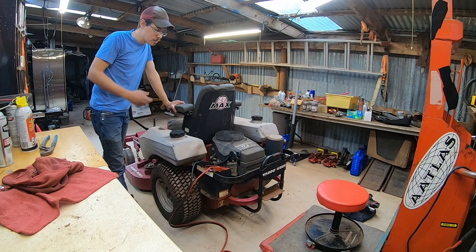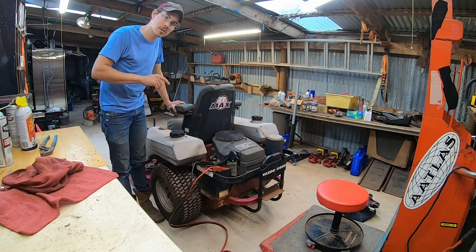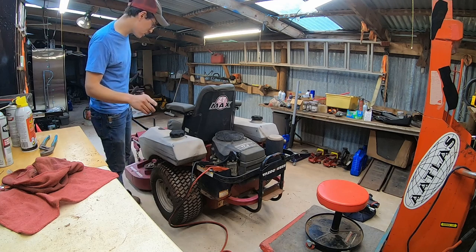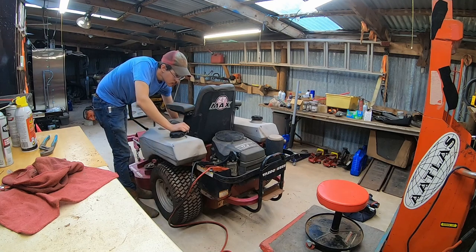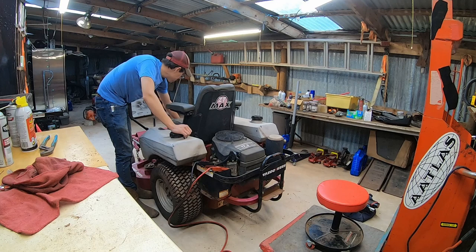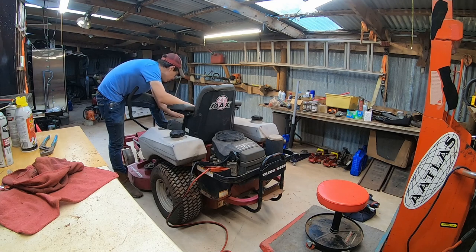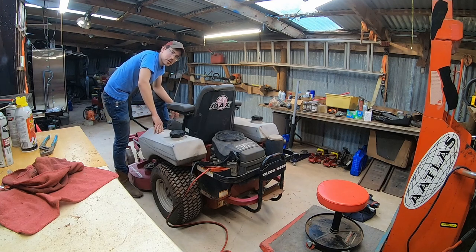All right, put the carburetor all back together. It's on there. And yes, there is a crossover pipe on the exhaust under there, so it could leak. So I probably really don't want to run it much like this, just in case the float bowl gasket will leak. But with that said, let's see if this thing will prime itself, get fuel into the carburetor, and start up and run. So it might take a little bit of cranking, because the carburetor is dry. That's a good sign. Oh yeah, it's starting to get a whiff of gas in there. Let's take it off choke. Feels like it's still a little dry.